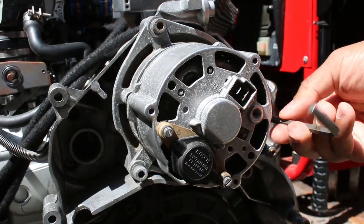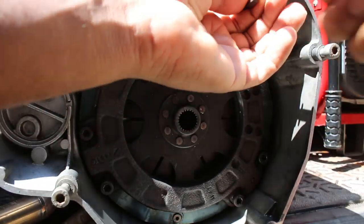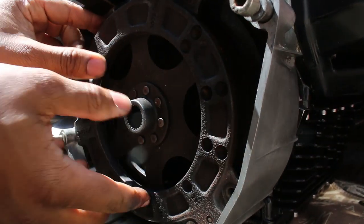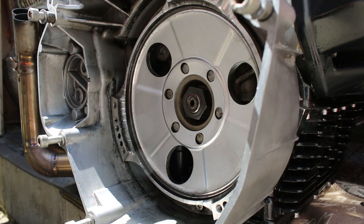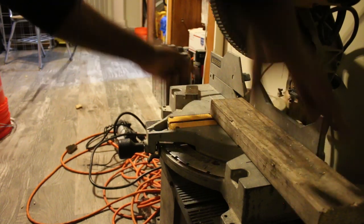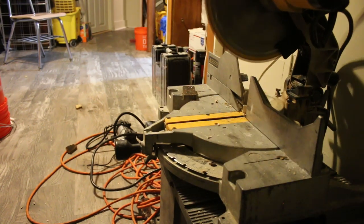To replace the clutch you don't actually have to remove the bell, but this was an all-in-one job — or so that's what it started as. Step one: remove the alternator. Step two: the clutch assembly. These six bolts and washers have to be replaced every time you pull a clutch out, although it's commonly understood that you can reuse them without incident, but at your own discretion. Now if you're replacing your rear main seal or removing your bellhousing, you have to lock the crankshaft somehow, because when you get your wrench out to remove either the clutch carrier or the alternator drive dog, the crank and pistons will just turn. BMW makes a tool to lock the crankshaft by locking the clutch carrier to the bellhousing, but good luck finding that. Some people make the tool by bolting a piece of aluminum with a specific dimension to the carrier and jamming it into the recesses inside the bell. Then there's people like me who just make do with a piece of wood and a prayer.